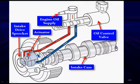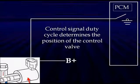The cam sprocket is driven. Now, this particular system uses one single cam drive. We're going to show you one later that doesn't. Notice the spool valve up there. Let's talk about that spool valve and how we're going to control it. We have duty cycle control. Now, this is one that's ground enabled, meaning we supply ground and it turns on the electromagnet.